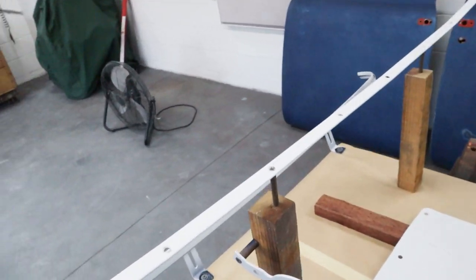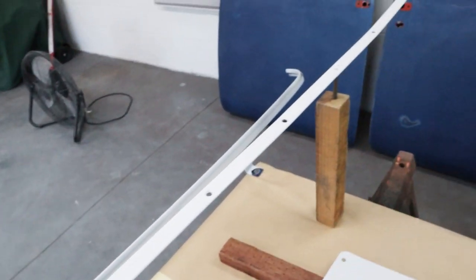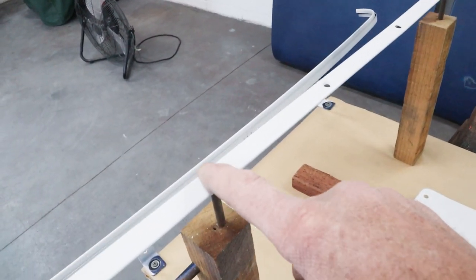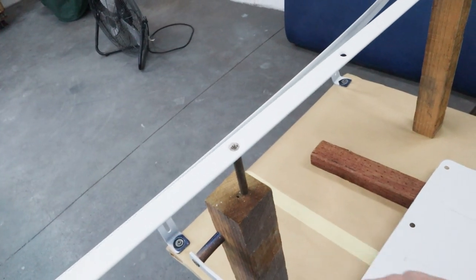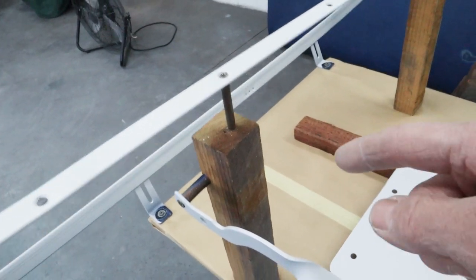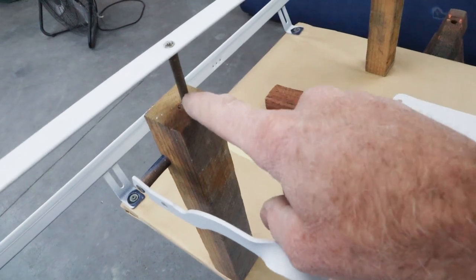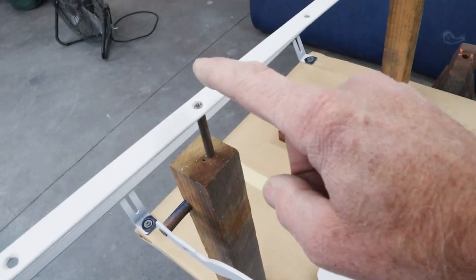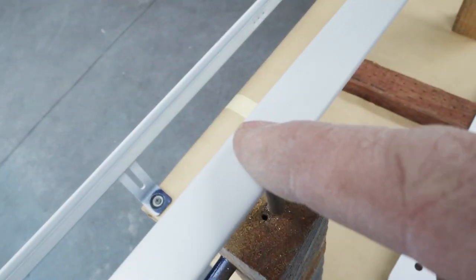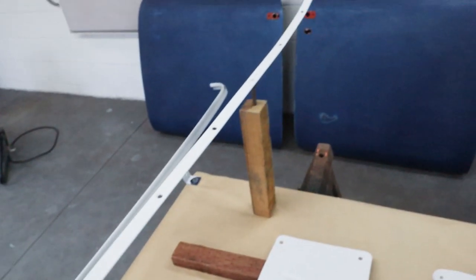Now this one is the part that goes for the headliner at the back window, I believe. And if you saw before, where I held it just down, I had it way low onto the plywood here, and I couldn't get up underneath it like I wanted to. So now I just screwed a couple of 1x1 blocks onto the plywood, and then used a piece of 1/4-inch copper tubing, ground the head small on the screw. As you can see there, it's just a tiny head now. And it's just bigger than that hole, so it holds it. And it's on there pretty stout now.